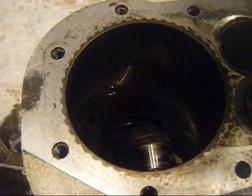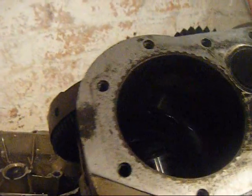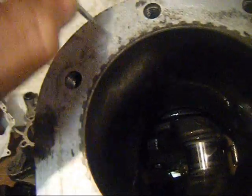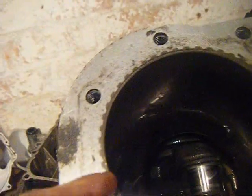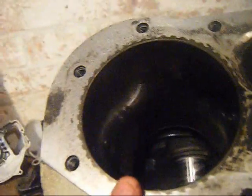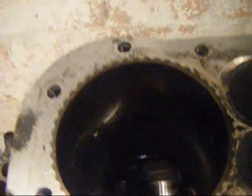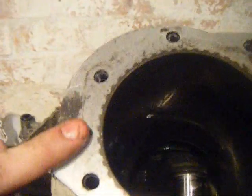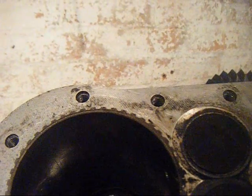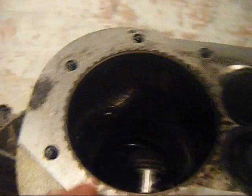It goes in your cylinder here, your engine block, which is made of aluminium. Then, out of iron, they cast a small sleeve. It's probably a lot bigger. Then they machine it down. The sleeve will be dunked in something like liquid nitrogen, super cool it, so it gets smaller. And then with the engine block, they'll heat that up, so make it expand. And then they'll use a hydraulic press to push this sleeve in, and you can see it here.